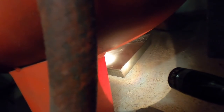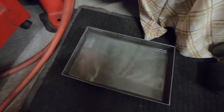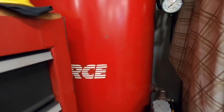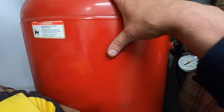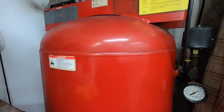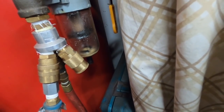Just let it spit out gently like that - there's no point opening it up and blowing all the pressure off. There's the water I got out of the tank - maybe a pint. With these upright compressors they get a terrarium effect when running; the top tank gets warm and it literally rains in the tank when it gets really hot from running air tools, DAs, air files continuously. That's why you get the water in the tank. My air traps have a little automatic drain so when pressure is released the trap automatically drains.